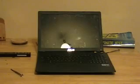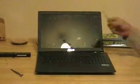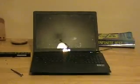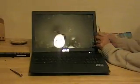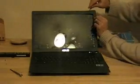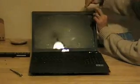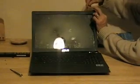Now I'm going to unscrew these little Phillips screws. All right, now the two screws are out. That was just simple screws. Now we're taking a little tiny flathead and slipping it in the side because there are a bunch of clips. These things are clipped in with those plastic tabs. It's looking good. Just to let you know where I am, I have unscrewed those two screws at the bottom, of course, and then I am now pulling this apart, and they are popping one after another. They're little plastic tabs stuck inside. When I get it all off, I'll be able to show you what the tabs look like exactly.